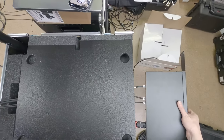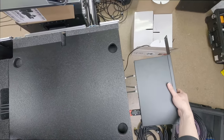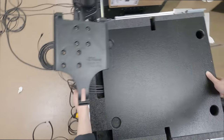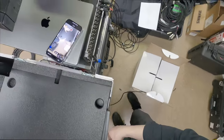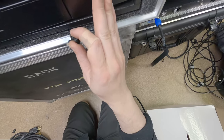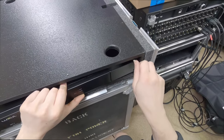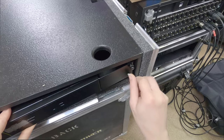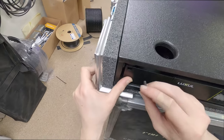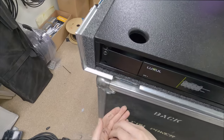For slack, I'm pulling the cables to about here so I can pull the router out and reach everything, then pushing it in so the cable slack lives within the rack section. If you make it too neat you'll never be able to pull it out. I've learned from past projects — don't screw rack screws in all the way until you've powered it on and confirmed it works, because you'll realize you forgot something.